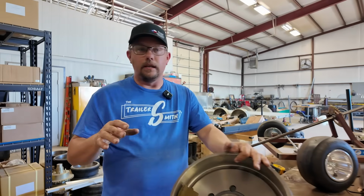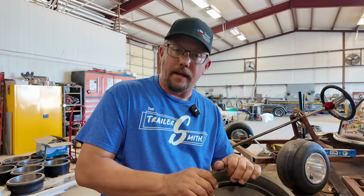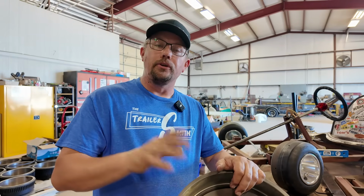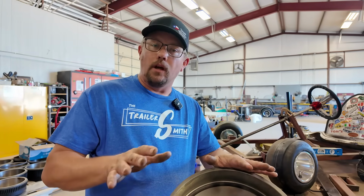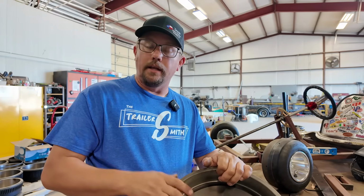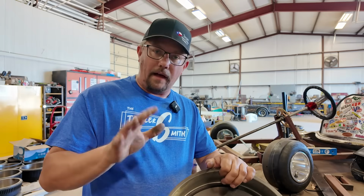The problem I see is we'll do a brake job for someone who says, hey, I'm leaving to go to Colorado next week. I discourage that, unless you're capable of doing your own brake adjustments. Even if you put self-adjusters on there, you have to know what you're doing. The first thing you're going to have to do is burnish those brakes in. We're going to leave a link in the description below for brake burnishing to show how that works.